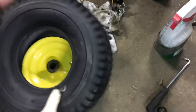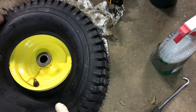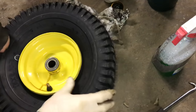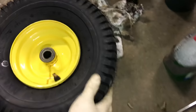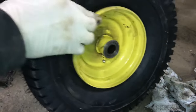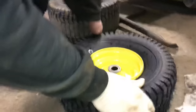So that one's on. I put my knee on the inside here and push it in. I like to have the tire bead in as far on the rim as I can get it, then start over a little bit at a time. This one went on very easily. Now the hard part — sometimes getting air in these tires you've got to try to get the lip to seal around here. I've seen guys put some kind of a seal around here, but most of the time you don't need that. There will be an air gap on the back side. This one's working out pretty good — you can see the air gap here. That's why it's nice to use compressed air if you can — it's definitely going to work better.